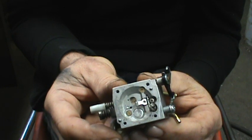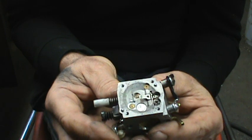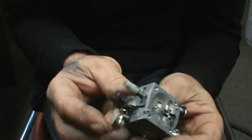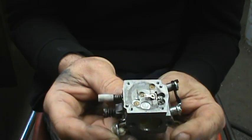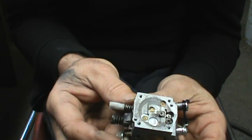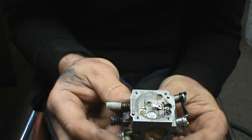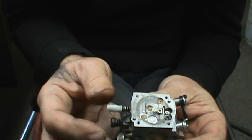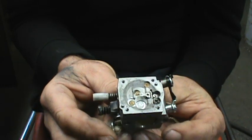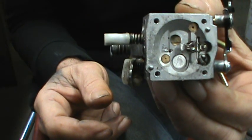But if you're having a cross issue with a carburetor, there are ways around certain things on carburetors to make them work again — that's what I did with this one. The low speed screw is still about one turn out. It doesn't affect that at all, but it does affect the high side quite a bit — instead of being a turn out, it's only about a quarter turn out. Fun stuff. Till next time.